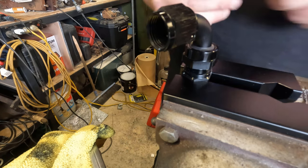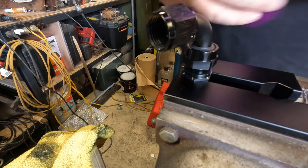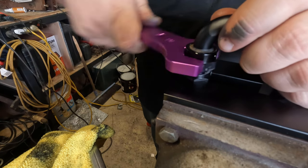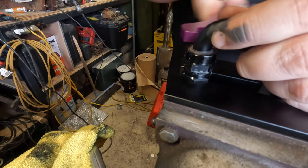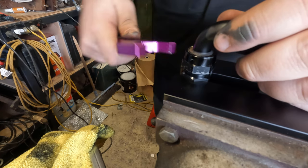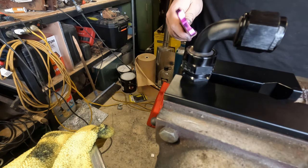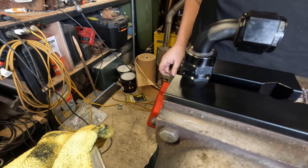We're going to use aluminium AN fitting spanners — that will allow us to not mark our AN fittings or the anodizing. These are a full swivel fitting, so they can swivel once tight. These need to be tight but don't need to be hung off. We're going to line our flats up. That's probably tight enough — I'll do the other end and then this line is made.